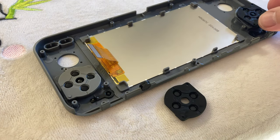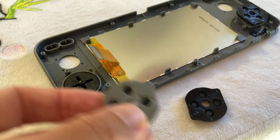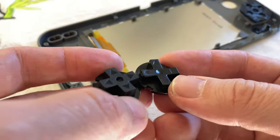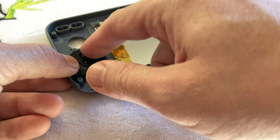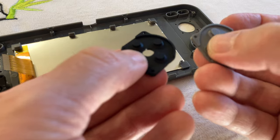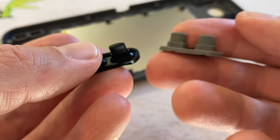Now that the sticks are sorted, let's switch in the membranes. As you can see, they're very similar in size, but the D-pad itself is not — the one on the OGU is much skinnier. If you wanted a thick D-pad, we'd have to modify the case itself. Just push it on. We should mention that the black membranes are a lot harder than the grey ones; it feels like they're made of a higher quality. We can do the same thing with these buttons too.